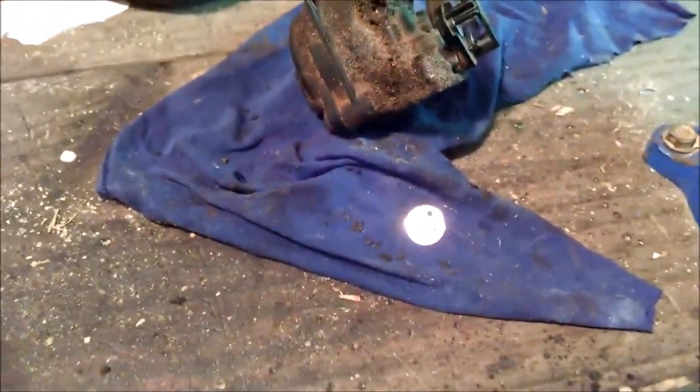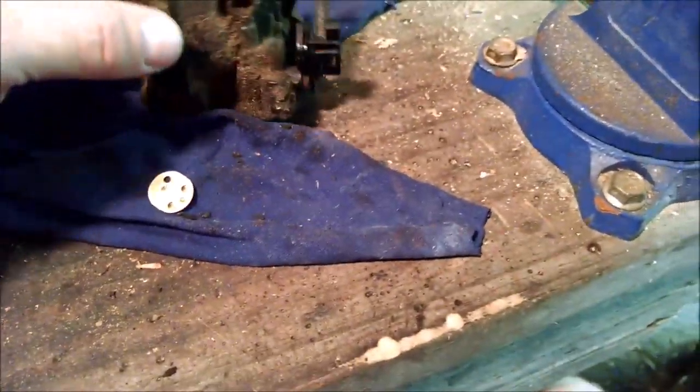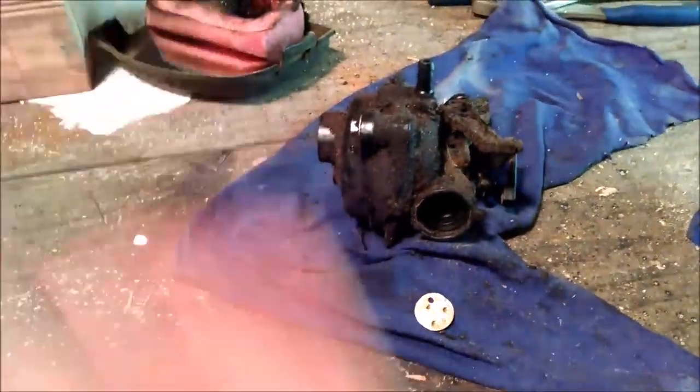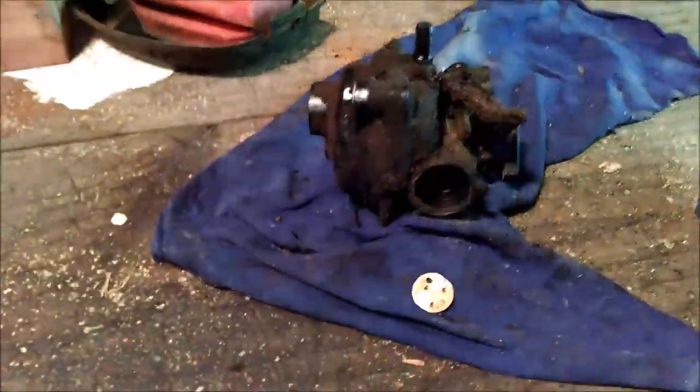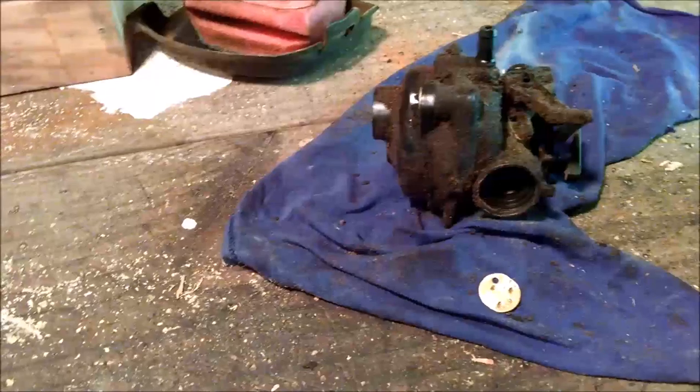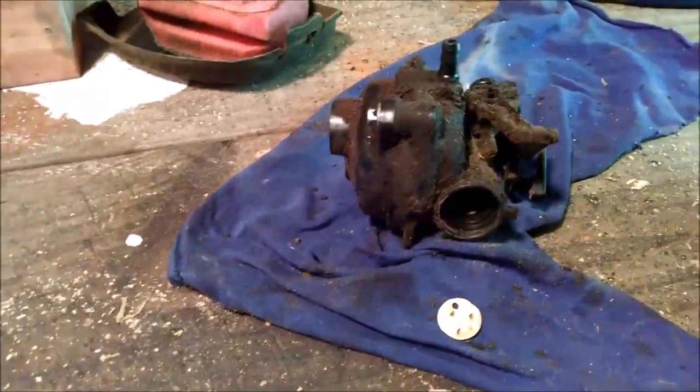Okay, so here we go again, right? Fixing things I shouldn't have to fix. So yesterday I just started mowing my lawn. I was about 40 minutes into it, and my engine just started revving up like crazy, way beyond what it should for having a built-in throttle control based on the governor.